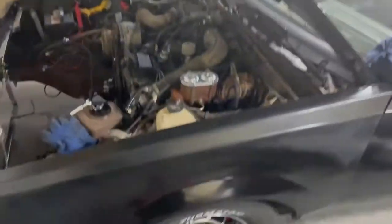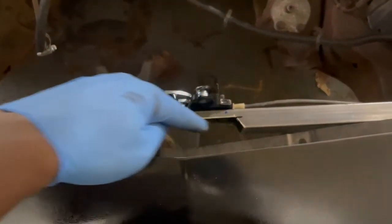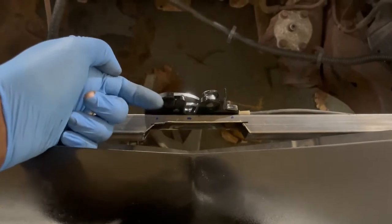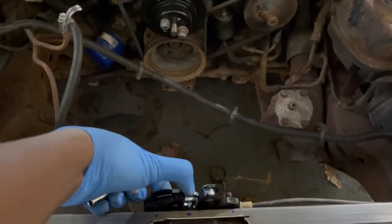All right, fast forward and the hood is on. I'm nearly done with final welding and I cut out this little access panel so I can insert bolts and tie in this latch — the cable and all that still works. The hood is as adjusted as can be. The major problem I'm running into is when the hood comes down it's not reaching this point to click in. What I'm going to do is weld this back in, take the bolts out, weld it back in, and have an extension piece come up here to give me extra room toward the hood. I can't tell by looking in the grille how close I am, and I don't even feel resistance.